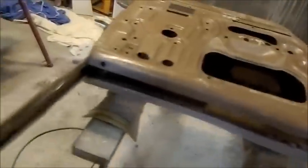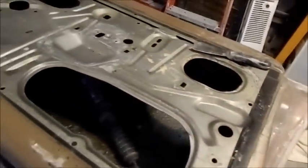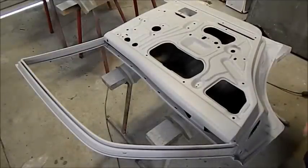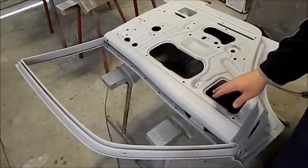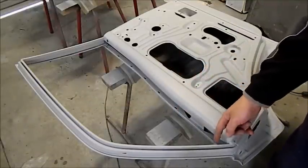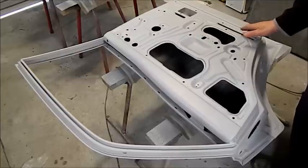I've thrown a bit of carpet down on these saw horses — that way it's nice and soft for the door to sit on and we won't damage any of the finishing we've done. We've still got to go over this and give it another couple of coats of high fill to get it dead level, and also clean up inside — this door is off a different car so we've got to make them ready to put on the car. While I'm ready to start painting the doors, I've just got to put this saddle colour down first. Normally in a Falcon 500 this is visible, but the door trims I've bought are Fairmont slash GT type, and there's a chrome trim that runs along the top edge, so the door trim folds over and you don't see most of it — just a little bit around the edges and this bottom kick plate.